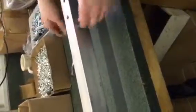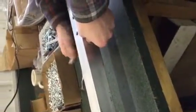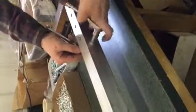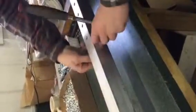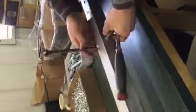Then you will shove your 5/16 bolt through the cylinder hole. Make sure everything holds together. And I'm showing you all this without using power tools because who knows what you actually have. So I'm trying to make it easy for you guys. Don't tighten that too much. It doesn't need to be too tight. If you tighten it too much, you'll actually damage the cylinder. So just tight enough.